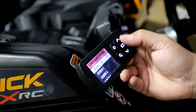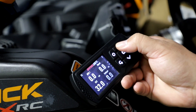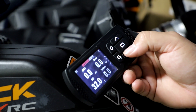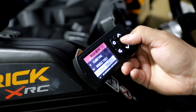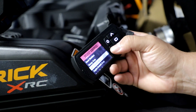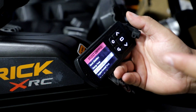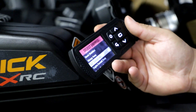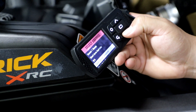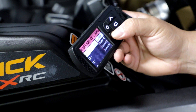Under device tools, you can configure your gauges — the gauges you can actually see on screen. You can set up multiple screens; there are four screens of setup. You can configure gauges and log data. One common concern: the EGT reading — that's calculated, not a real exhaust gas temp sensor. These devices do not have an EGT sensor, and it's just an inferred value. The other values are important and accurate, so scroll through and pick the good ones: battery voltage, temperatures, air-to-fuel ratio, boost pressure.